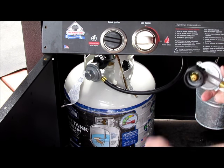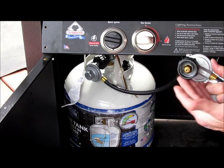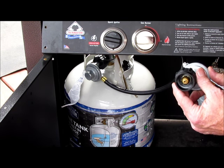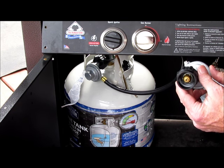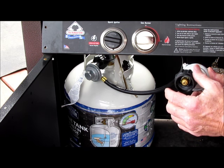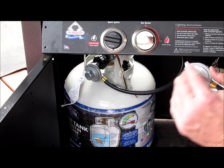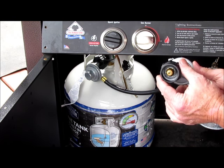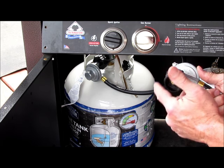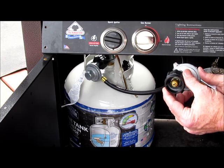This is the regulator hose that's attached. Inside this coupling is a safety valve the government put in years ago, and it's a good thing. It's designed to detect a leak or to prevent you from having an explosion. But sometimes weather — cool in the mornings, hot in the afternoon — can cause pressure to build up inside the connector check valve, and then cause a situation where it's not getting the full volume of gas.